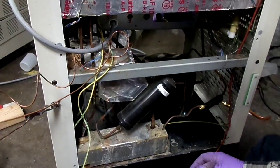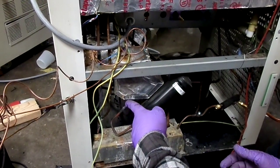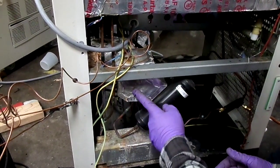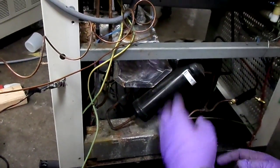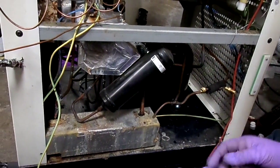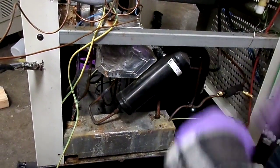Things that come with the kit: a new E-valve assembly, a new tube, and a new filter dryer. It does not come with this other tube here, so we have to save that one or fabricate a new one. I like to reuse it because it's metric copper, and if I fab a new one I've got to use a new T-fitting — it's a pain.